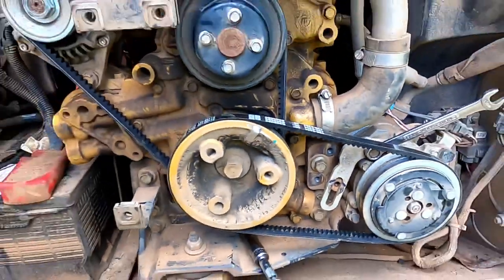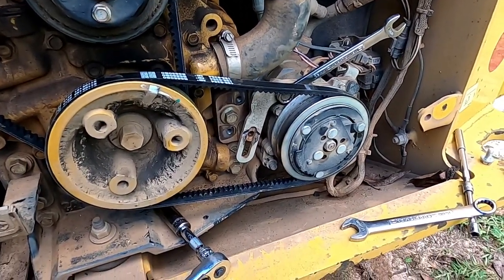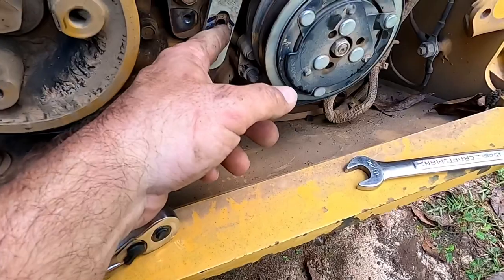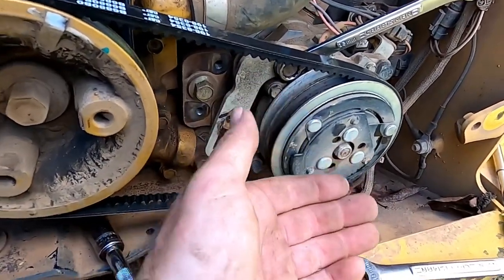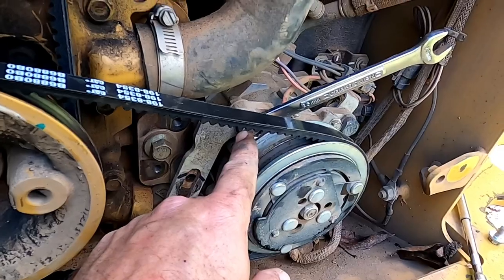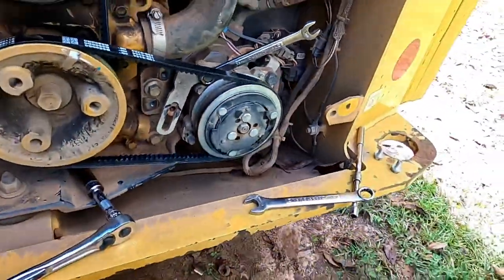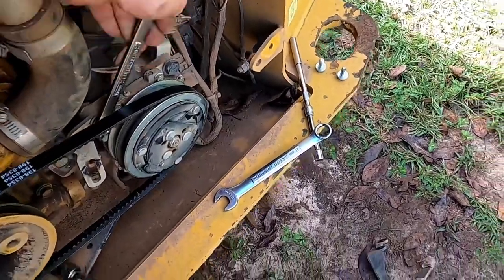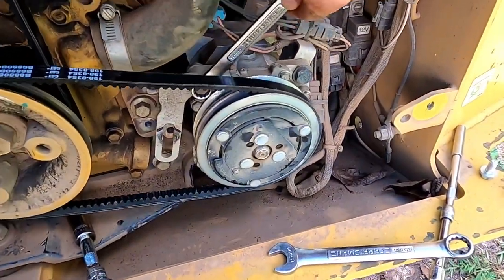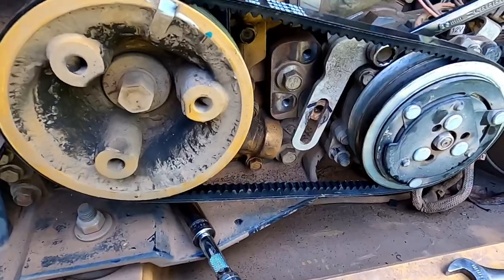It's hard to film since I'm so close to the work, but on this compressor belt — I took off the bolt, actually just loosened it at first so the bracket would go up and down, thinking that would give me enough room to put the belt on. Well, it didn't give me enough room. So I was going to take off the hardware for that bracket and put the wrench on there. I pulled the compressor up quite a bit — enough to where I could get that belt on. I just wanted to show you that since it was a little tricky.